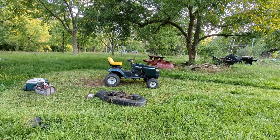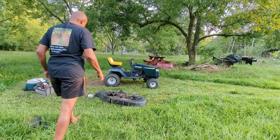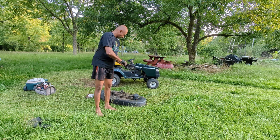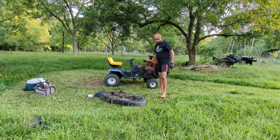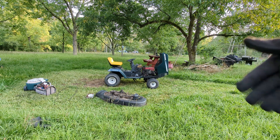It's hard to get under the mower, so first you have to remove the deck. It has little cotter pins — you just remove it. The transmission belt is underneath. The easiest way is to flip the mower over. Make sure the dipstick is on this side so the oil won't drain out.